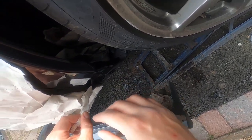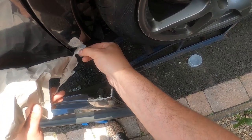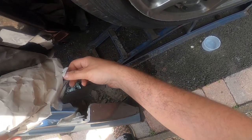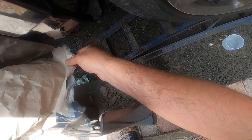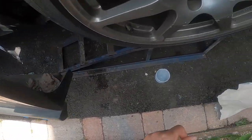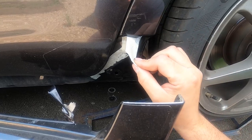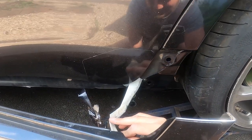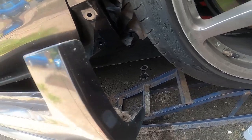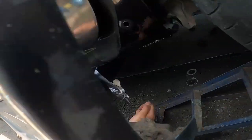This is the problem when you use tape that's a little bit too sticky, and also with the heat. This is why paint booths are a thing, guys. You want to be pulling away. If you left this on and it dries, it'll sometimes peel off and flake the paint. You can see the lines from the tape - and I'm an amateur obviously. If you were a professional paint shop you would have cleaned all this and then blended it in by polishing and stuff like that.